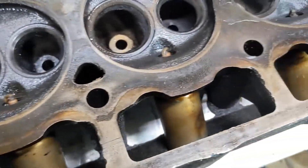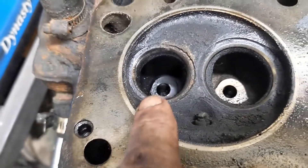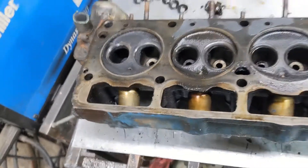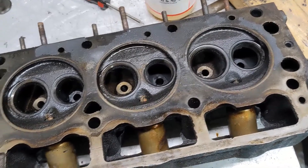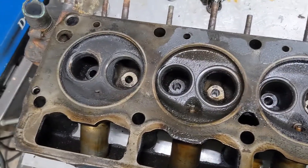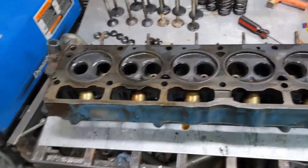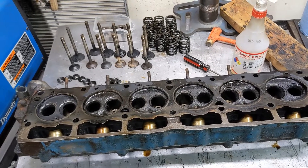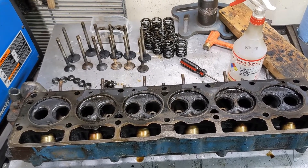The bigger concern here is these valve seats. Take a look at number one — it's super chewed up right in through there. You're not going to get much of a seal at all there. Most of the intakes look pretty good, and that's actually pretty common — the exhaust valves are the ones that really take a beating. All of the seats look good enough that with a little bit of lapping they'd be fine, except that number one exhaust — it is really hammered. I think that has to be ground. I don't have the tools to do that any longer, so I'll see if I can find somebody that does. There we go — here's the top end taken apart. Still have to take apart the bottom, but I'm not overly concerned because I don't intend to reuse it, at least not anytime soon. That's all there is to it. Thanks for watching.